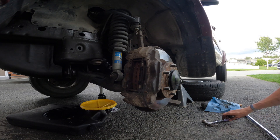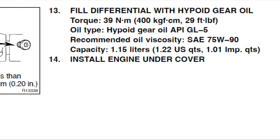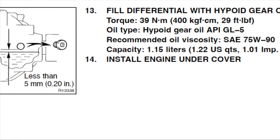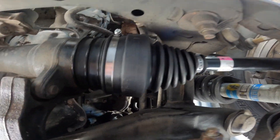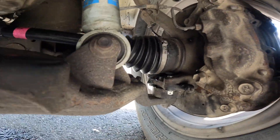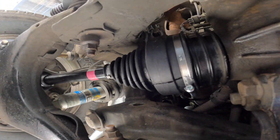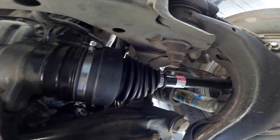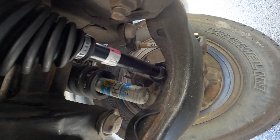After you get both sides complete, just make sure you re-top off your front differential with proper gear oil fluid because you did lose some of that during the installation. Here's the complete picture after about a 50-mile drive the next day — everything's looking good, there are no leaks. Just keep monitoring it, because sometimes when you're putting the CV axles back into the differential you can fold one of the rubber seals in there and it'll cause you to leak differential fluid. So just keep an eye on that, and thanks for watching.